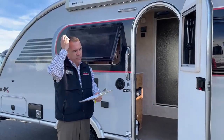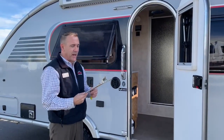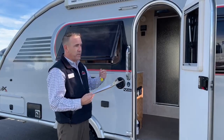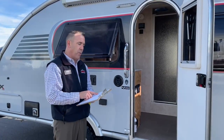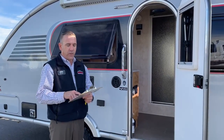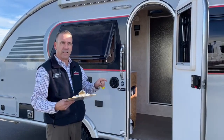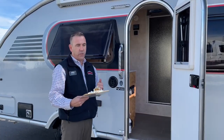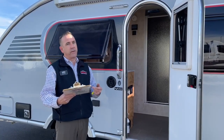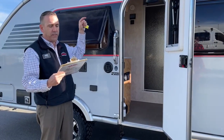The whole length of this trailer is 21 feet. The width is 7 feet. The height at the very top is 9 foot 1 inch, and the interior height is 6 foot 5 inches — so anyone over 6'5" will need to duck. Dry weight is 3,140 pounds, GVW is 3,800 pounds, giving you a payload of about 660 pounds including water. Fresh tank is 20 gallons, gray tank is 14, black tank is 9. The awning is a 6-foot awning and the AC is 13,500 BTU.